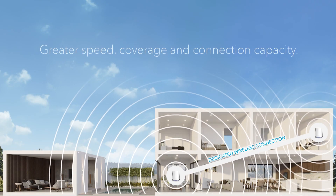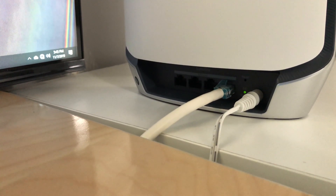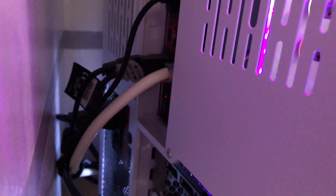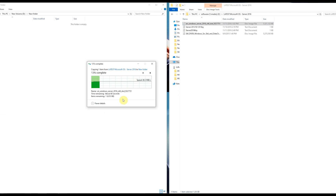Now we're going to do a 2.4 Gbps backhaul Wi-Fi speed test. In this test, our local NAS device is connected to the Orbi Wi-Fi 6 router via Ethernet, and our desktop is connected to the Orbi satellite via Ethernet. We're transferring close to 6 GB of data over the 2.4 Gbps backhaul. We're getting close to 80 MB/s or 800 Mbps transfer speed — not the full 2.4 Gbps because the NICs on both router and satellite are 1-gig, which is the limiting factor — but overall good results.